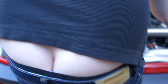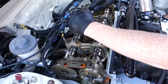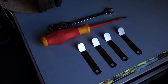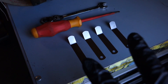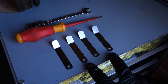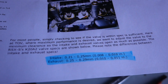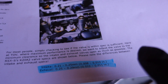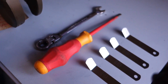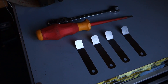Those are the numbers if you're just watching this video and doing it. These are the bits we're going to be using to do the job - we've got the two correct size feeler gauges and then one size up on each one. As you can see on this document there are tolerances and specs, so what we're going to do is try the bigger one first, and then if it's out of spec, put it back down to the correct one using the correct feeler gauge.